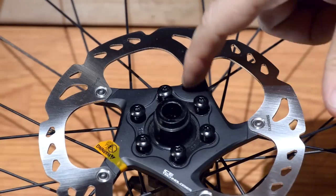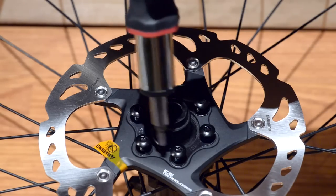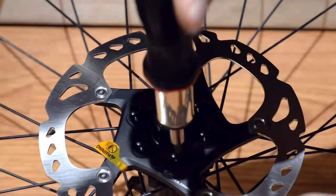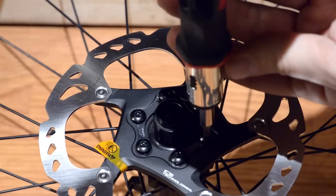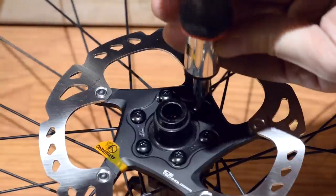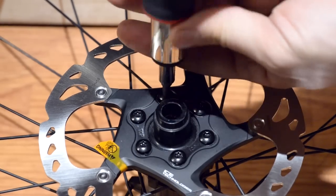I installed the three plates — they just sit in there. Then I had the six screws. I wouldn't use any sort of electric screwdriver when you're starting these screws. Most hubs are aluminum anyway, so just start them nicely and easily by hand. As you bring the screws closer, you start hearing the screw head touching the tightening plate. That's my sign to stop, meaning I've brought all the screws close.